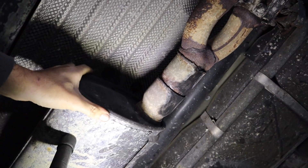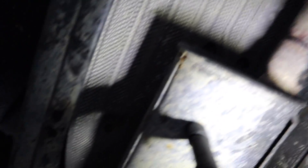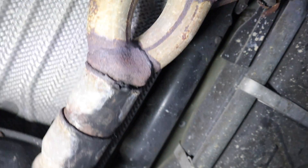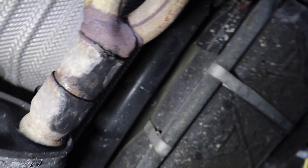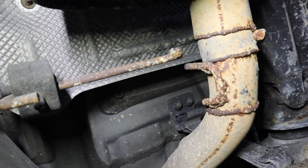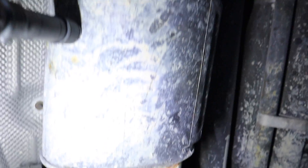So what I found was actually this - this is my exhaust, and if you can look right there, I think someone did this aftermarket or whatever, because this ML sounds really quiet. And it's not even welded around here - someone might have added this resonator in, and it's shaking right there, and the actual strap is in pieces. So I think what I was hearing every time I went over something hard was just this, just shaking everywhere.